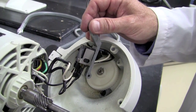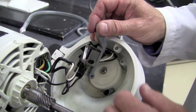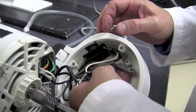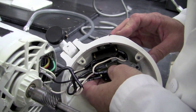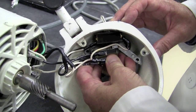The next step is to reattach our automatic switch or micro switch. Note the actuator plate — this is what actually engages the micro switch when the unit is in the off position and the pin is depressed through the nylon gear, so it's important that this is facing downward. That will put us in the proper orientation to secure the bracket to the lower housing.